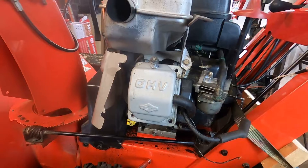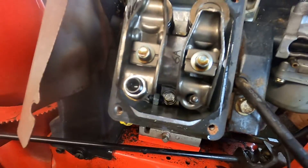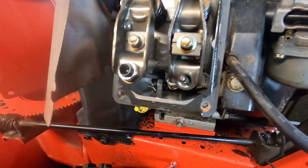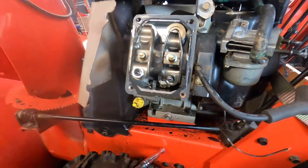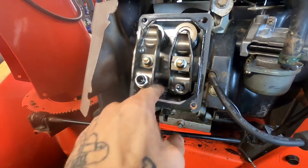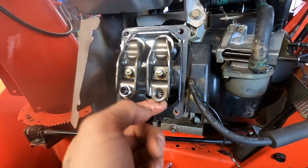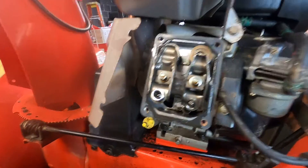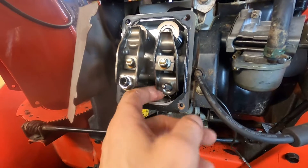Good gravy, friends — I'm glad I didn't waste too much time on the intro for this video. Pulled the valve cover off and that's what we're staring at. Big deal. What happened was the top end of the valve rocker assembly came apart. The push rod is no longer actually acting on the rocker arm. So I'm going to find a diagram online to make sure I've got all my parts and figure out what went wrong.